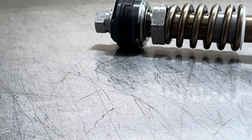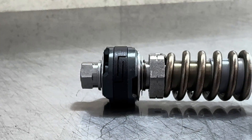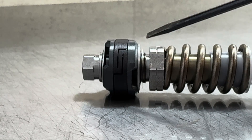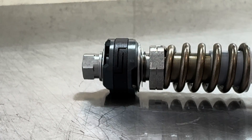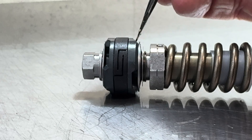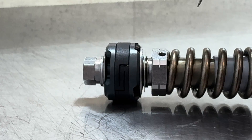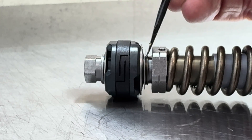The mid-valve configuration that comes inside of a WP Exact Pro 6500 or WP Explorer Pro 6500 — as you can see, between all of them we always have the same mid-valve piston. This is what we call the older style shim-style mid-valve setup. We have our shims against the piston face, and behind these shims we have a small compression spring. As these shims lift off the face, this spring is what puts tension on the shims and helps them seal against the piston face. On the leaf spring setup, we're replacing this spring with shims — shims create a leaf spring to replace the job of this coil spring.